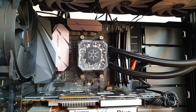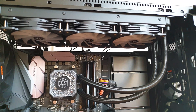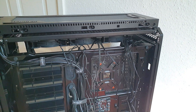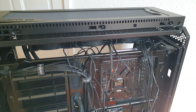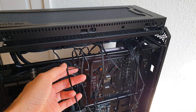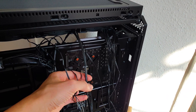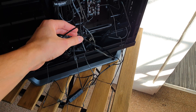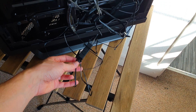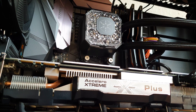As you can see, there are no clearance issues around the socket area and the existing tubes have plenty of space to not interfere with the RAM slots. Regarding the cable connections, it's pretty simple if you look at the manual. I used the remote since my motherboard doesn't have a 5V RGB port, only 12V. The fans connect into a Y splitter that goes into the CPU fan port, while the pump's 3-pin goes into the AIO pump header. For the RGB, connect the AIO RGB proprietary plugs first into the remote, then each fan into the next one.